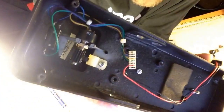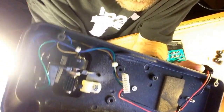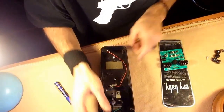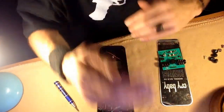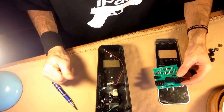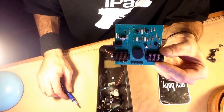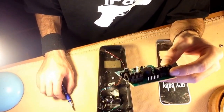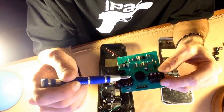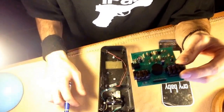Dan's pretty pleased with the performance of his pedal and how it sounds, so we didn't really want to change it past that as far as that aspect of the sound goes. In other words, he likes the Q — he doesn't want to change the Q. He wants to change some parameters within the Q, which we'll do by replacing and switching out some components on this, but the Q he wanted to stay pretty much the same. So the inductor — that'll stay the same. We're not going to change that out.